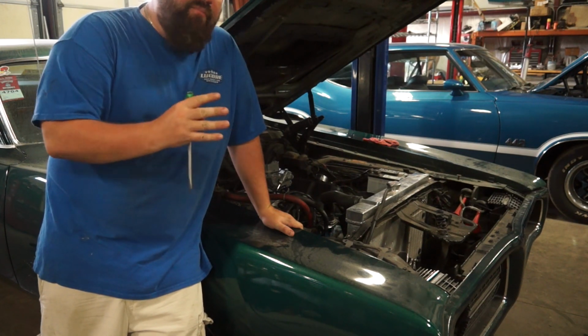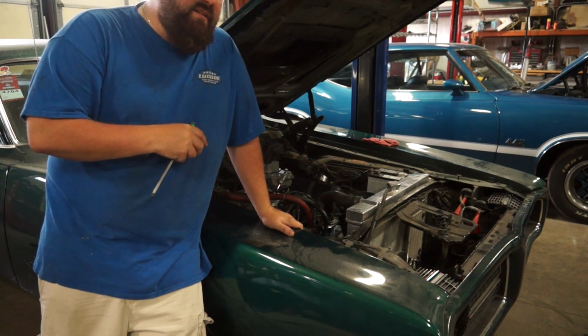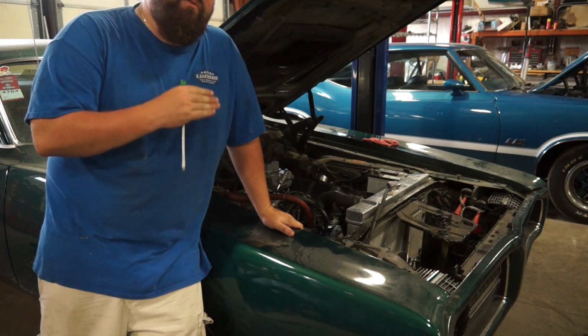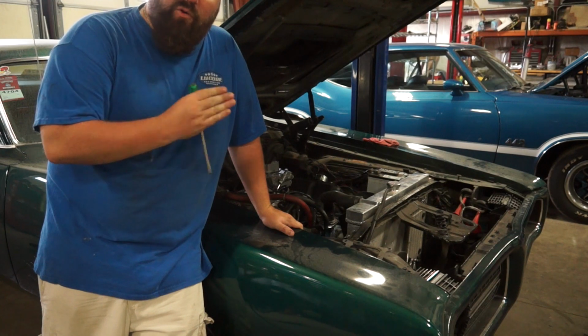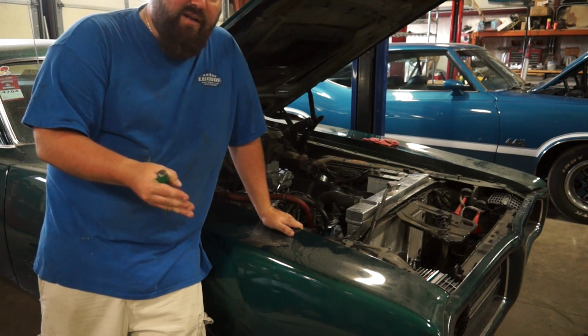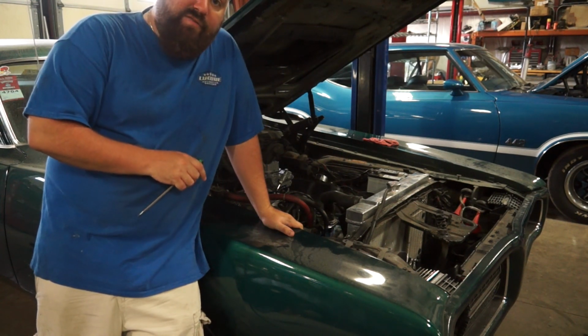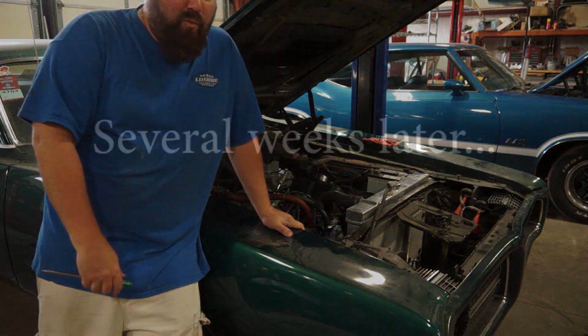We were seeing it break up pretty badly on the top end. So in addition to the heating issue and some of the other problems, there's a very good chance we also had fuel pressure dropping on the high end of the rev range. And if you're not holding fuel pressure all the way up to the top, it's going to start breaking up, and that could be what we're seeing. So that's the long story of replace the damn fuel pump. So, time to replace the fuel pump.